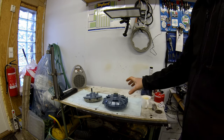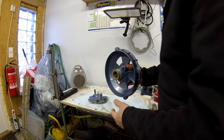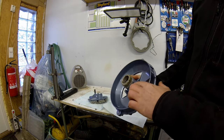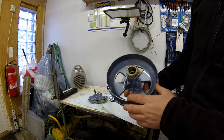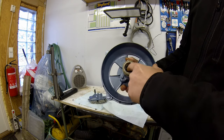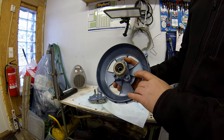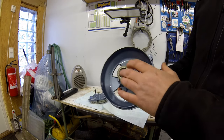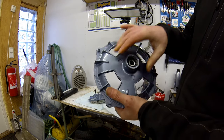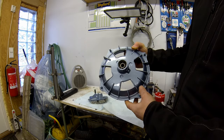Before I start rebuilding this I've got a couple of issues I need to sort out. First off, the speedo drive looks pretty good but it's all been painted into the hub. The bearings don't actually turn - they're really rough. I think what happened is it was sandblasted with the bearings in, so they need to come out. I've got a bearing puller on each side so it's just a case of opening the circlip and pulling them out.